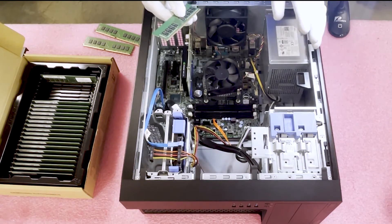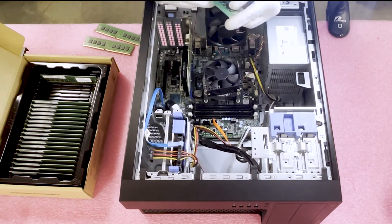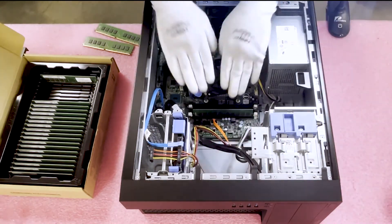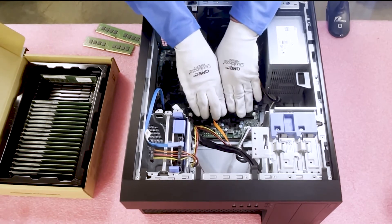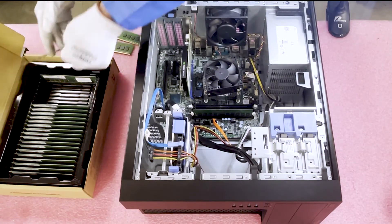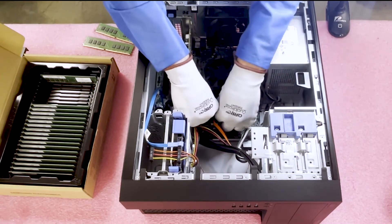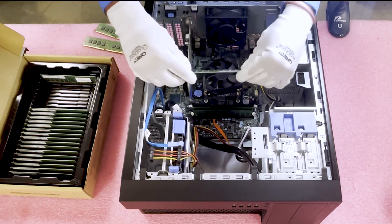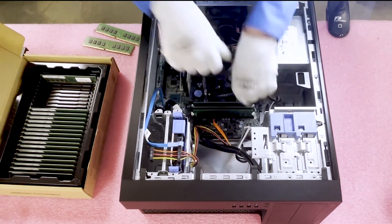We're going to go ahead and load it up. Before I start, I make sure all my tabs are fully open so I'm not fumbling around when putting the modules in. I need to line it up properly. You can see I've taken my hands off — it's fully in there, but it's technically not fully seated yet. What you really need to make sure is you hear this click. That click lets you know the module has been fully inserted. Too often consumers think they've run into an issue with a failed module, but nine times out of ten it's just a seating error — very common. We always tell customers to rotate their modules around just to make sure everything is properly seated, and you can hear a nice little click sound each time.